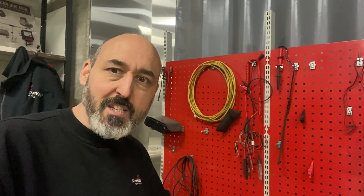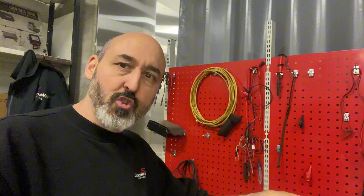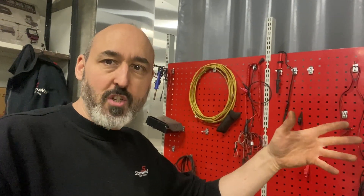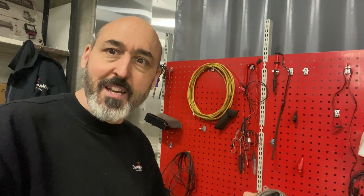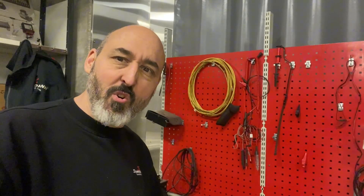You can scope the BSD signal — it's a bit tricky to get to, so I always recommend going to the alternator connector. If you've got multiple BSD faults and there's no signal, or it's shorted to ground or to 12 volts, you'll need to start unplugging components. That's why they got rid of BSD — it's not reliable at all. It's always better to have a dedicated LIN line just for each device, which is what they do nowadays — separate lines, much better.